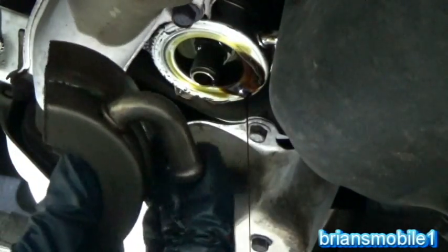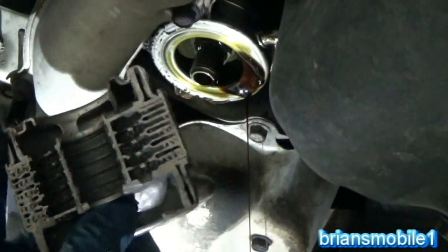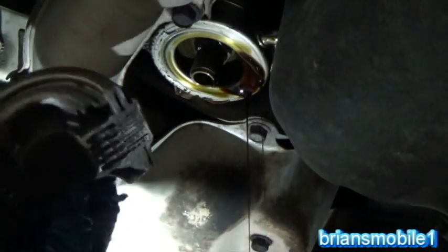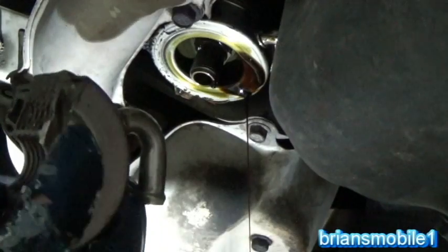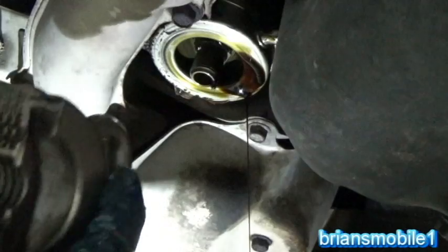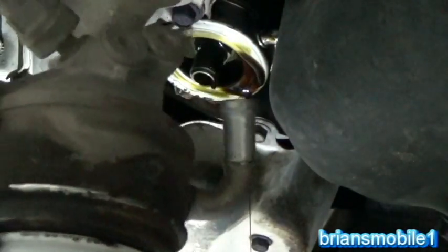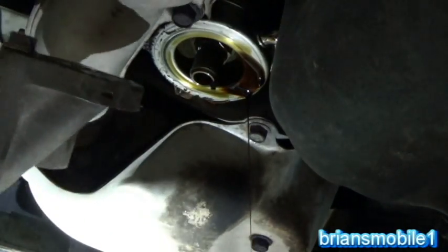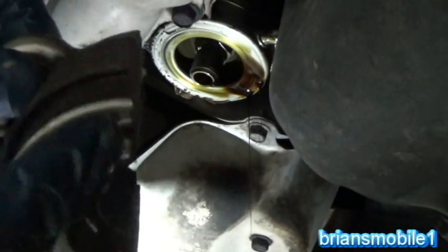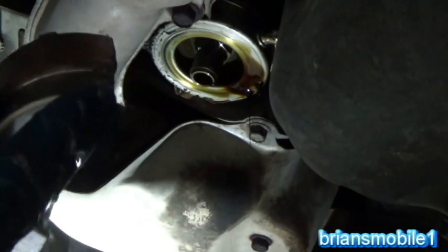What we're looking at here is the little cooler line. You've got coolant that's going through and then oil that's going through. The oil is going to go through the channels on this side. There's a little hole right here that oil passes through and then another one on this side. Here's what it looks like all together with a filter on it — this one has an adapter plate — and where the o-ring is, is right in here. You can see a little casting where the o-ring goes and then your oil filter would seal on this surface.